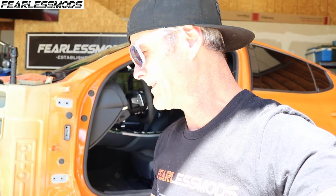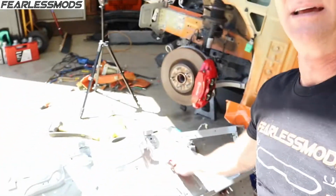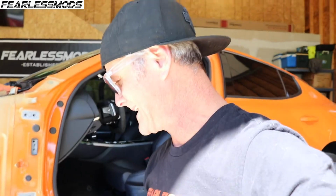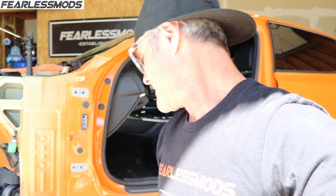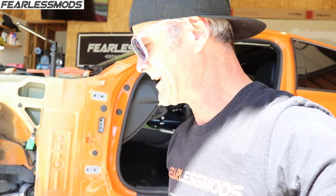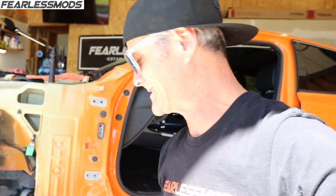to start peeling all this apart, and that's not going to be fun or easy because I don't want to damage any of this metal that's here, the good stuff, and while these are drilled out, you never do quite get all of the spot weld on all of them. So if I have too much trouble, I may have to come back in there with a 3/8 bit just to kind of get the top layer a little bit better of a release from any of the surrounding parts of the spot weld that I might have missed because I wasn't perfectly center punched on them.